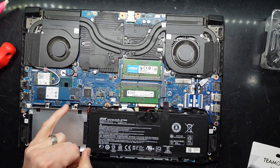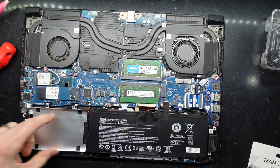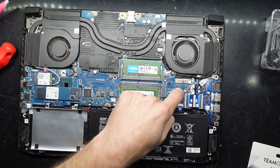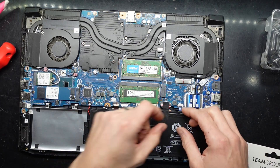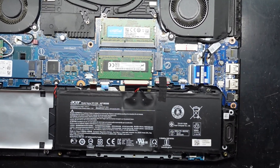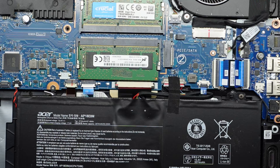As we can see we have one NVMe over here, two sticks of RAM here, the battery, and a 2.5 inch SATA hard drive here. We're looking right here at the NVMe slot. Usually I wouldn't bother, but for the sake of safety of your device I would recommend disconnecting your battery.